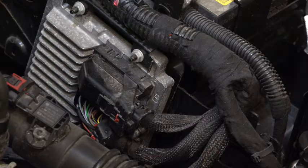A lot of times you're going to have to scope a sensor circuit, or maybe a solenoid — some output — and those things may be in an inconvenient place to get to, so it may be more convenient to do it at the PCM.